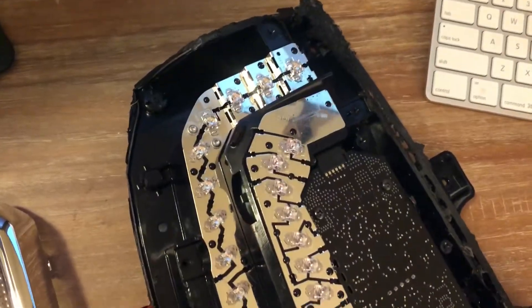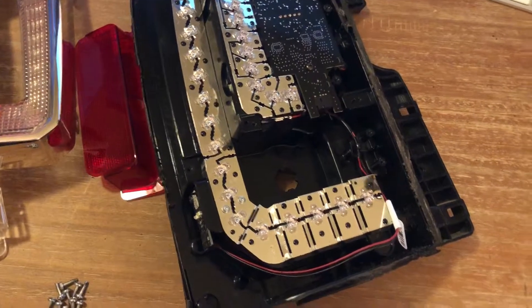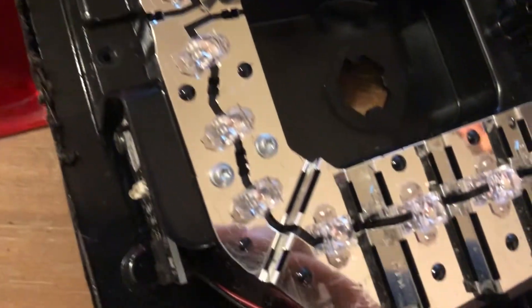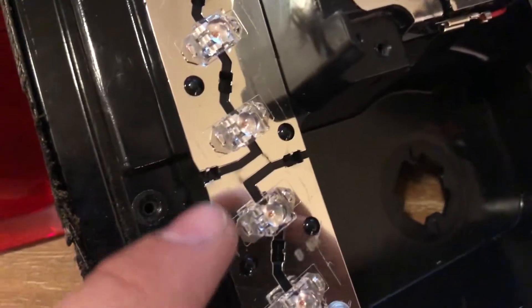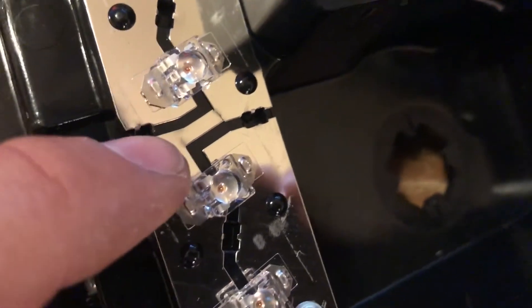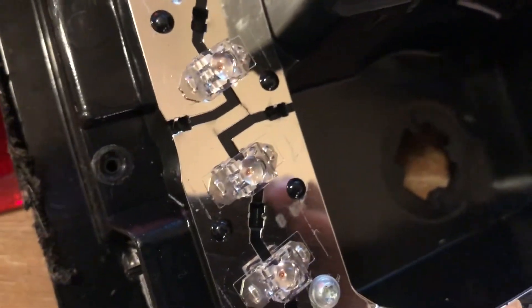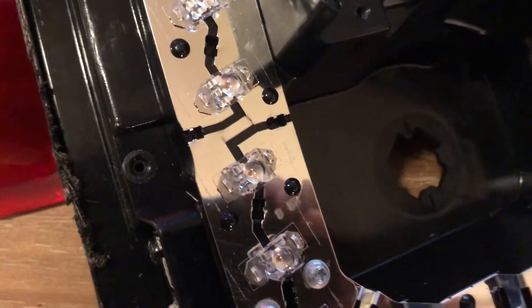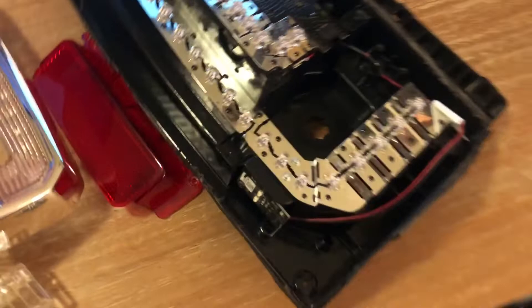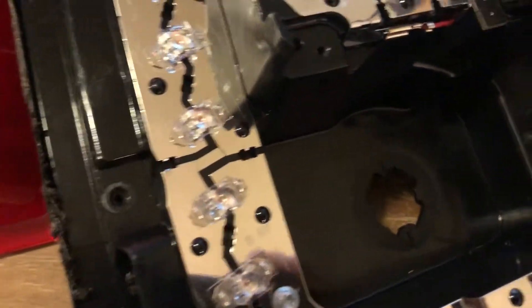I really didn't find anything unless I twisted it — it would shut off. What I ended up finding was that halfway down they actually switch spots, and then it goes up to this side. If you look real close you'll see a split right there. Whenever I kind of twisted or tapped it, that connection would remake and the taillight would start working again.